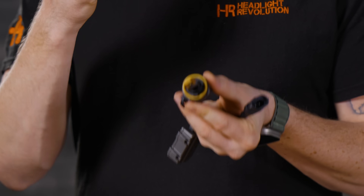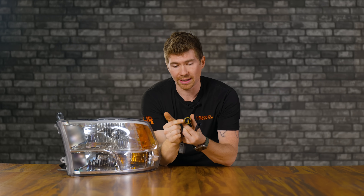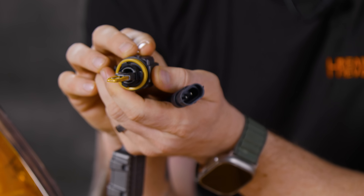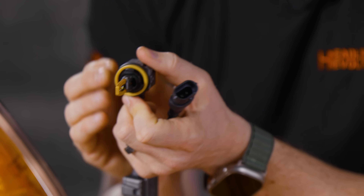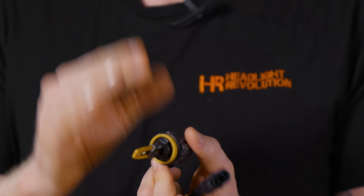So is this bulb a complete flop? No — it was brighter than the 3.0, and to me that's a win. Now, to get those beam patterns I adjusted this bulb properly. In a stock reflector headlight housing, the mirrors go vertical, so the LED chips need to be shooting outwards — the bulb needs to sit upright. You cannot have it tilted to the side. Since a lot of housings are different, you might need to align it. The 3.0 bulbs had adjustability, but that adjustability would sometimes wear out and it would just keep spinning — and that's not what we want.